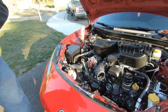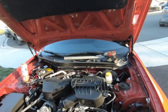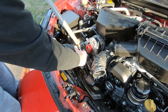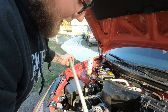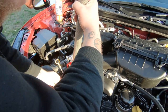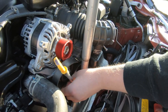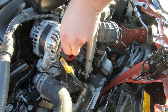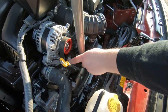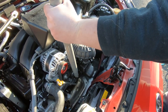You also want to make sure the logo is up top, just cause it looks better. So now, where did we put the jack handle? Probably not wise to put it right by the windshield. So yes, I have a breaker bar and adapters — I only have one adapter left cause I break them. Get this out of the way. I want to show the people that you can do this with one person. Make sure you get it on the tensioner, bring it up, and onto this guy. It will be a little bit looser putting on than the stock one. Then go through and make sure the belt's fully lined up with everything.